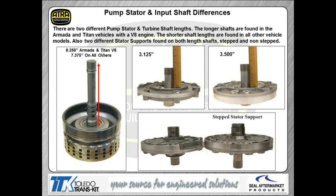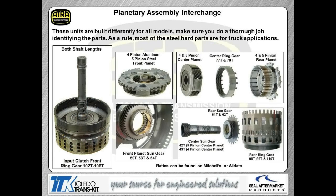Now, in your shop, if you're not having this issue with whatever converter supplier you're using, on whatever fluid you're using, you don't need to change anything. It's just a little heads up if you do run into a problem. It seems that the Honda fluid is straightening it out, so the regular Honda automatic transmission fluid.